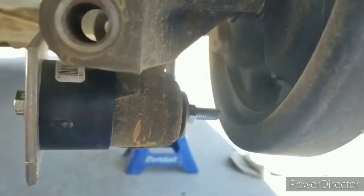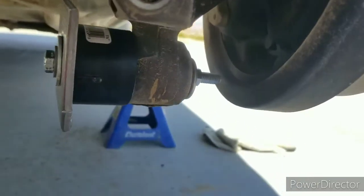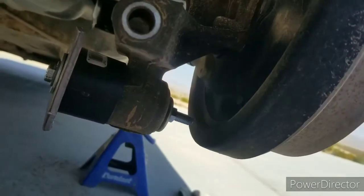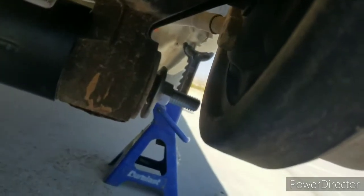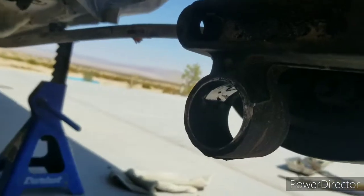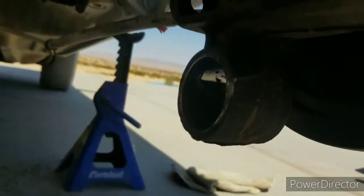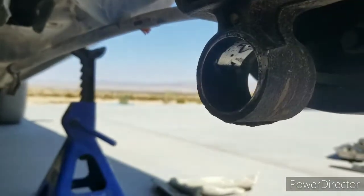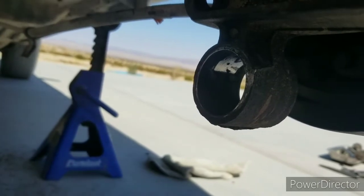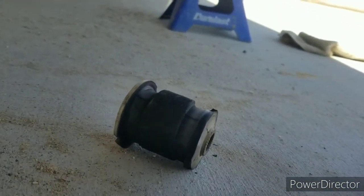The heads are 14 millimeter. With your 3/8 bolt, just start wrenching. You can use an impact but go slow — it's just cheap hardware, not meant to be banged on. You could also use hand tools and start pushing it out. You don't even really need a washer on the nut end — it'll just pull the whole thing through once it gets going. Out she comes — there's the hole and there's the bushing. It only takes a few pulls of the wrench, and once it's halfway through the rest just falls out. Don't overthink it.